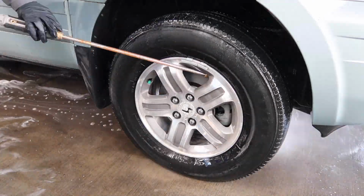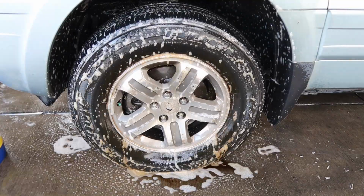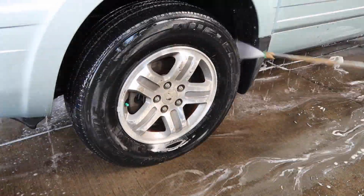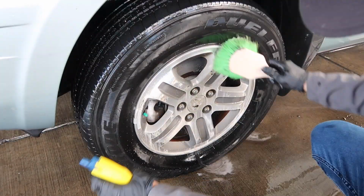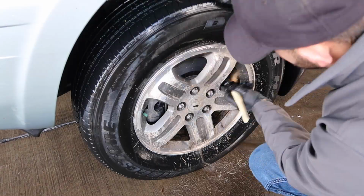So one thing that really gets to my nerves is when I see these detailers use really diluted degreasers like 5:1, 10:1 on a filthy tire, and then they'll go over it like 3 times and it still doesn't come out clean. That just really gets to my nerves. If you're going to clean a really filthy tire, use a straight product, don't get cheap.